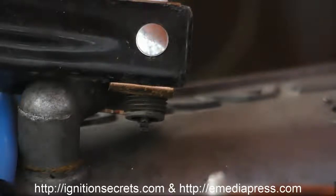And keep in mind that the capacitor for the regular MSD with the regular spark that you saw is going to be the same capacitor with the same joules of potential energy, but I'm causing a negative resistance effect for that to discharge at an accelerated speed, compressing all that energy into a smaller unit of time, which is going to massively crank the power up. And that's how you can get megawatt impulses from very small sources of potential energy. And it's not just an enhanced spark, it's a completely different plasma phenomenon. It's a high-speed disruptive discharge. It's actually a little bit more sophisticated than the typical disruptive discharge that Tesla was using. And so this is the impulse that will instantly dissociate hydrogen from a hydrocarbon molecule, or even from water, or anything else that has hydrogen on it. And so we'll go and start it up and we'll see what the plasma looks like.